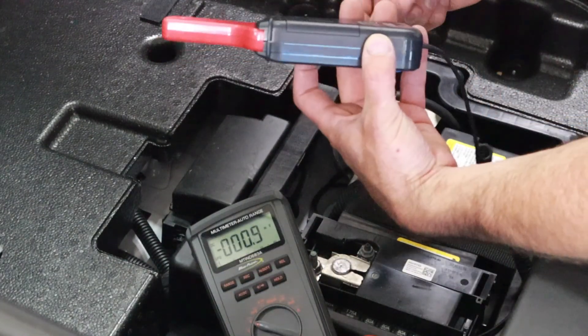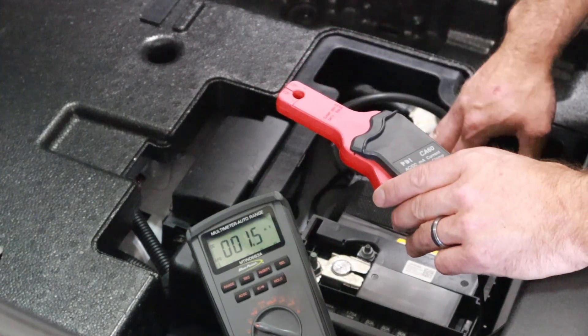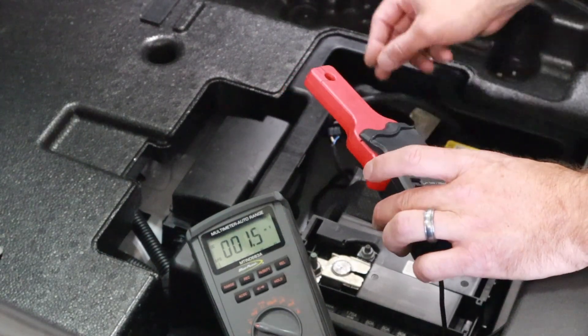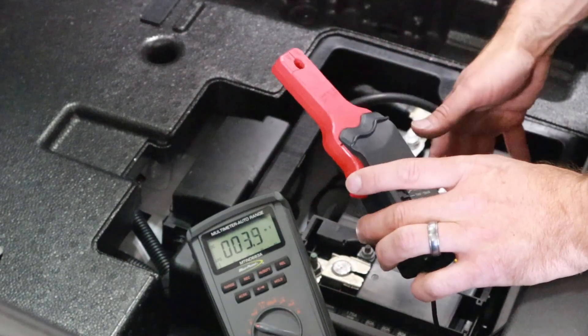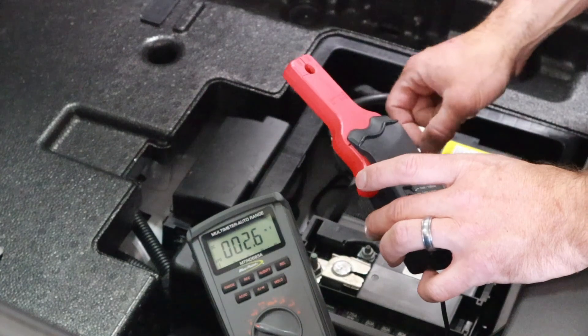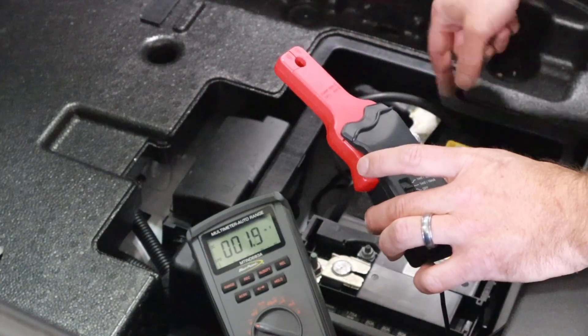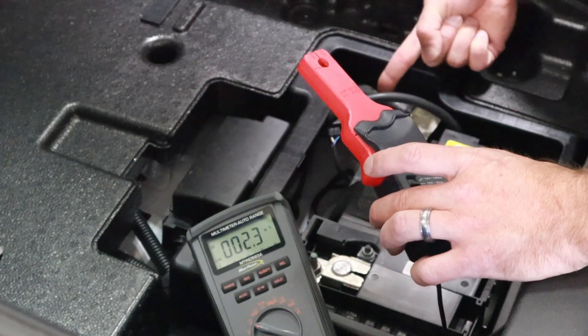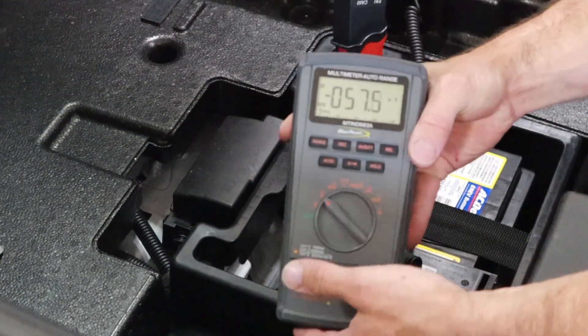What I want to look for is that my number returns to zero or near zero each time. Once I'm at zero, I'm gonna take my lead and connect it to one of the battery cables. I could be on the negative or the positive — it's really just a matter of getting everything that goes to the battery. If there are three or four cables that come off the positive post and I only pick one, I'm not getting the whole picture and I would have to go through each one. My negative cable is a single cable on this car, so that's gonna be my best choice.